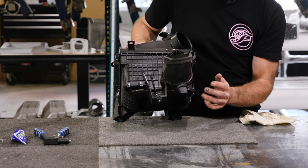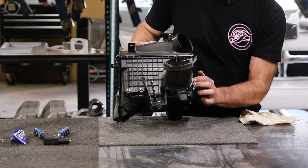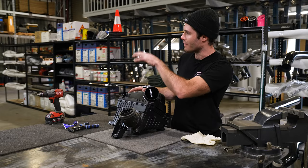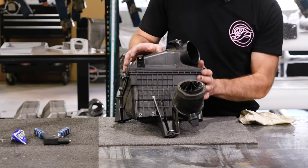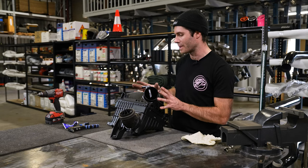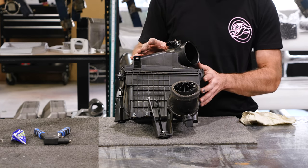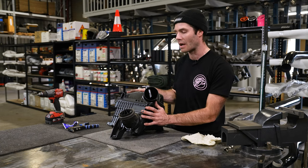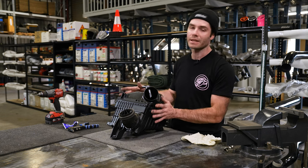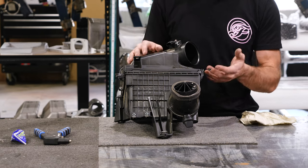So what we do, we'll remove the small spout, remove the foam, drill and rivet this section, because this section's already sealed, drill, rivet, and seal this section to make sure that everything we touch is fully sealed. The only other point of water ingress may be this seal around here, which is why we don't ever offer these as a fully sealed unit, and it's why we offer our fabricated airbox as the only option to be fully sealed. We do stock and sell the 2020 plus BT50 and Dmax fabricated panel filter airboxes, and they take the standard panel filter. So for serviceability, you just rip the top off, replace the filter as per your factory airbox.